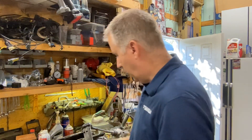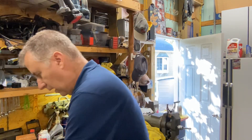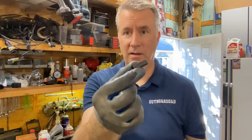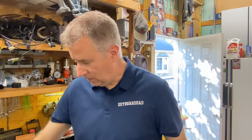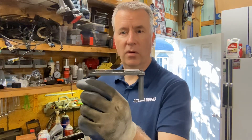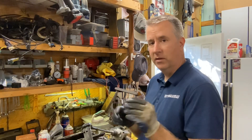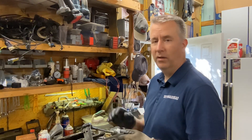I JB welded a piece of teak wood on the stone and also modified the wipers so I have a nice even wear. There are two stones modified that way. I save the extra bits so I can continually make more of these. I glue everything together with epoxy, then work them in an old block in and out to make sure they're shaped and round. With the wooden block extension, I can work just the bottom of the cylinder without working the top at all. Then we're going to measure and get close to where we need to be with our piston wall clearance.